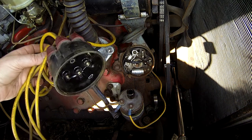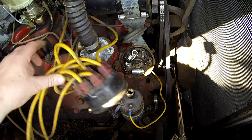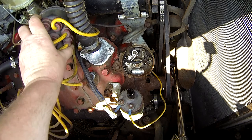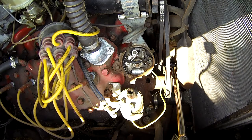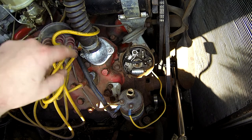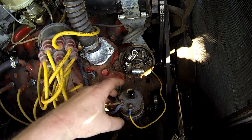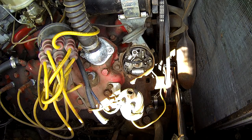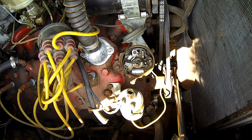We've got a new cap, and the existing one still looks pretty good inside — a little worn on the center connector but nothing really gummed up. I should get the old cap out of the way now. I'll mark the wires later and make sure they go back onto the new cap properly, or I'll just swap them off one at a time. So that's kind of an overview of the whole thing — I'll start with the coil since it's right here and clearing it will give me more room to work.